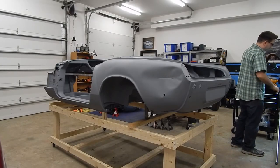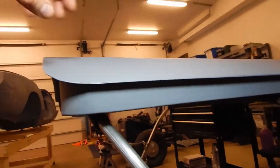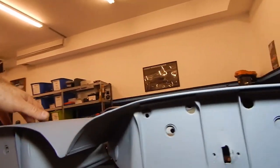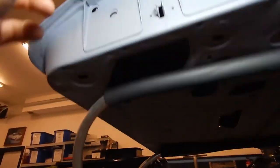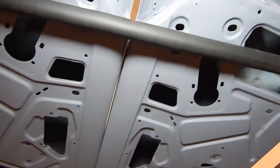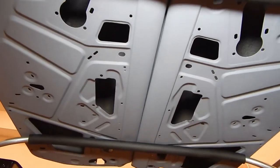Super quick — here are the doors. There's a little bit of denting on the door skin, same on the other one. A little bit of pitting. But here's the cool thing about these doors — we showed them before they were blasted — look at that: there is no rust whatsoever on the bottom of the door. Even on the inside, there's no rust on these doors. So yes, there's a little bit of outer damage to the door skin, but the door structures themselves are very, very good. These were done and coated as well, so these doors are good to go.